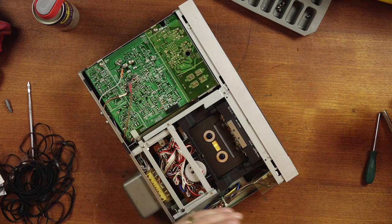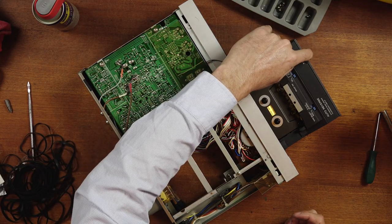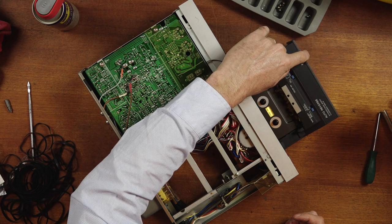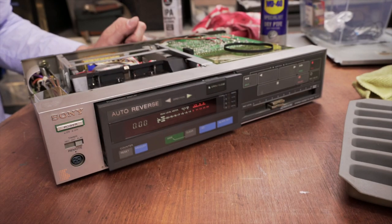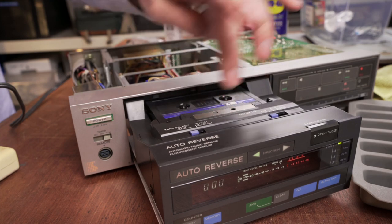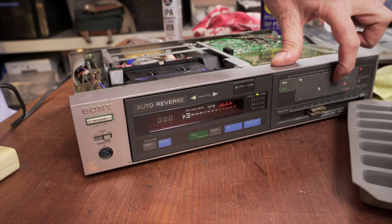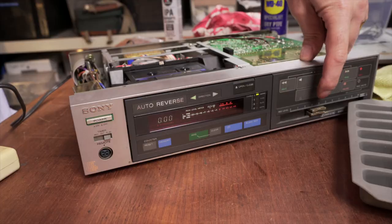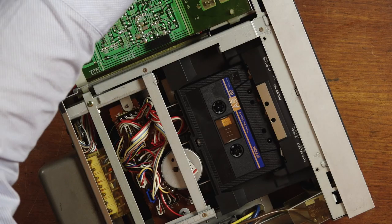Take two — I've got the new belt on, that's the old belt there. Ah, that's way better! So it did need a new belt as well as the new grease. It opens all the way to the stopper, and you can hear the motor turns off once it gets there instead of keep running thinking it's still moving. Now we know it's working — let's throw a tape in and see if it actually plays anything. It's not happy, it's not turning, it's not engaging. Let's try rewind — no. Fast forward — same issue, nothing much there.